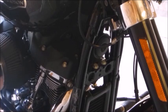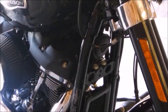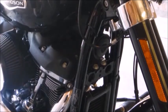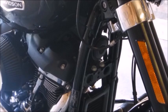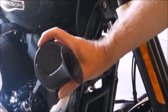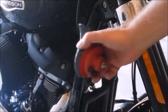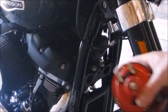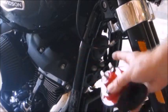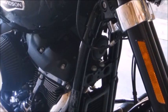We all know that the standard horn on any motorbike, no matter what the make is, is pretty feeble — it's pretty naff. So what we're going to do here, I'm going to swap out the horn which is located at the front with more of an air horn. On previous bikes I've had I've always got this sort of horn because they're better. The ones I've had before only got one terminal and the earth is taken off the nut, whereas on the Harley one there's two terminals, which is why I've bought this one. There's two terminals clearly marked — red which will be the positive coming in, and the other one going to earth. It should bolt into the same hole without any problems whatsoever.